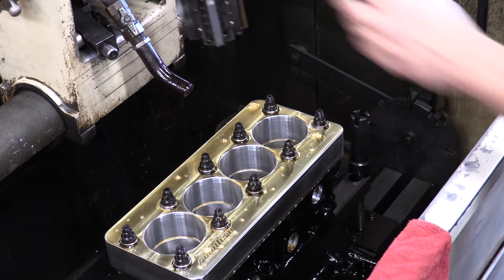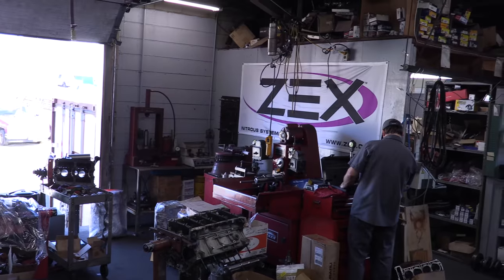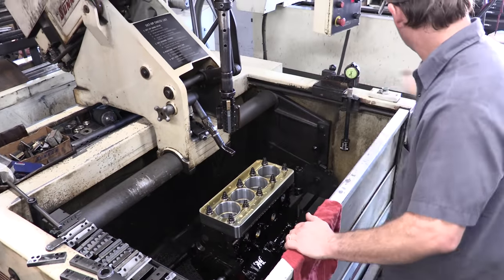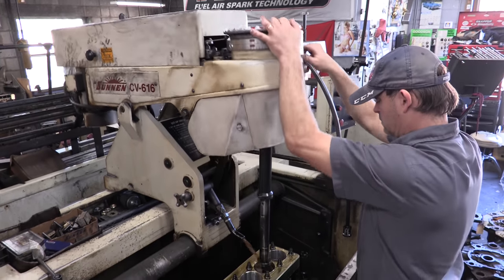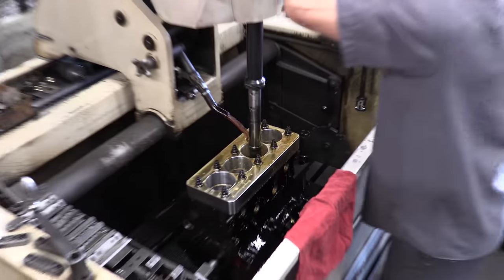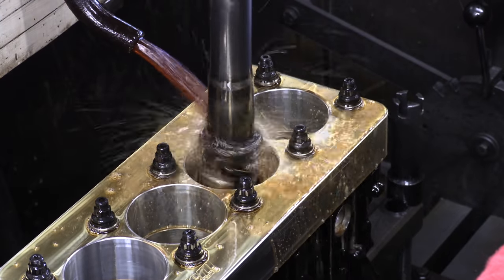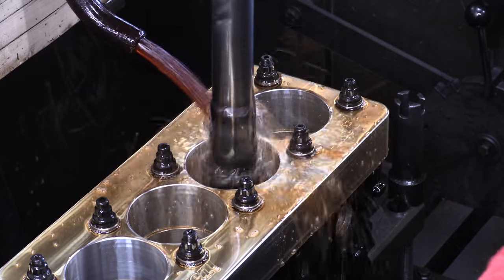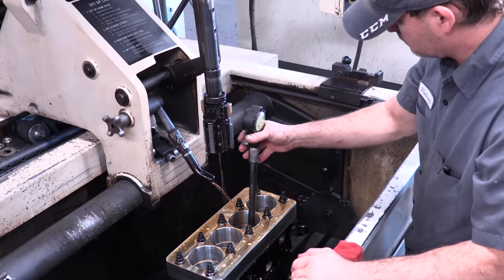Thank you, Stuart. That concludes the topic of thermal expansion. I illustrated in my previous segment how most metals expand approximately 6 millionths of an inch per inch of material per 1 degree Fahrenheit. Well, machining parts requires friction, and therefore it generates heat. Over the span of 6 inches of material, including the holes, a 10 degree temperature difference will certainly show up in the 10,000th spot of a measurement. A machinist has to deal with localized heat because they generate it, but the assemblers don't have to deal with it because their parts are all acclimated from being stored in the same place.